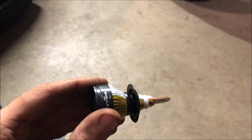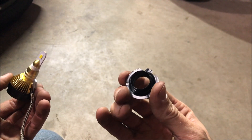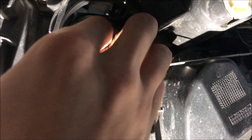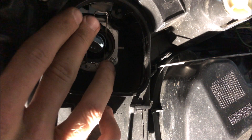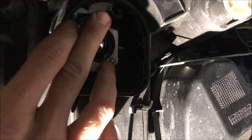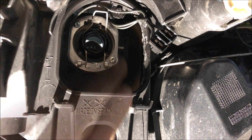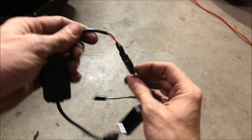To start the install, the first thing to do is remove the little glass protective shield. We're going to take the little adapter plate off of the headlight itself and install that first by itself. It goes in one way — make sure it's firmly seated. Lift that wire clip back into place and lock it back in. I did have to bend that clip a little bit because there's a clearance issue with the fan, but it's still working and firmly holding the adapter plate in place. Now we can install the bulb itself, making sure it is aligned vertically so the LEDs are sticking out to the sides.